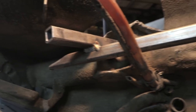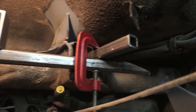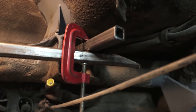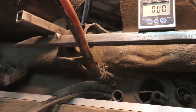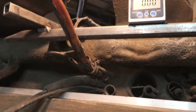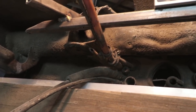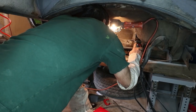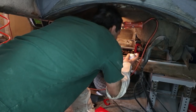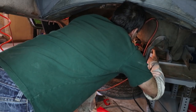I just welded one side solid, but I'm not going to weld this side because I'm afraid I won't be able to get this thing out — the angles of the mounts are such that it can't pull straight back, and it can't go straight down because of the transmission mounts. So I'm going to carefully mark this side with some spray paint, and then I can reproduce it at a higher position when I get the new holes drilled.